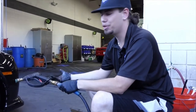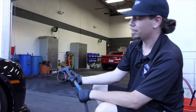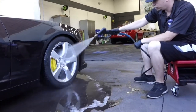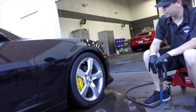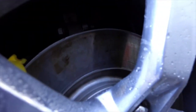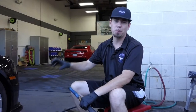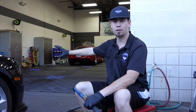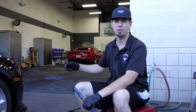We're going to use a pressure washer to rinse all this down — you can use a hose or whatever you want. We use spotless water, which makes things a lot easier with the really hard water here in Arizona. Just rinse all the chemical out really thoroughly. Don't worry if you see a little rust on the faces of your rotors — some people freak out about that, but as soon as you drive and brake a couple of times, it'll wear right off. That's just unprotected bare metal. Now we're going to continue around the rest of the car and hit the remaining wheels.